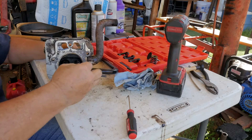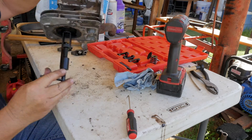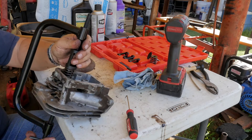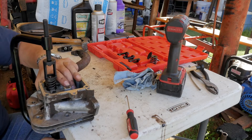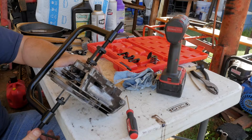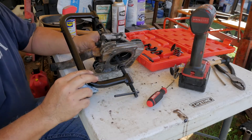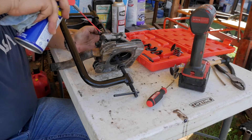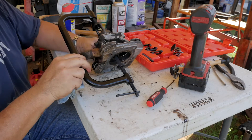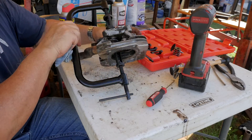This exhaust one is a toughie. Hopefully I won't ruin the valve itself - it is just not budging. I probably should get some eyewear just in case. I'm going to back it out a little bit and I don't see it moving at all. That's going to be a tough one. I went and got my eye protection just in case things go flying. I'm going to spray a little WD-40 on this seat and see if that'll help. I don't know if the seat has already come all the way out and it's binding on the edge.